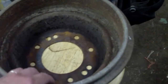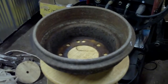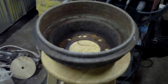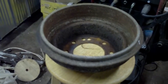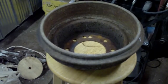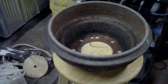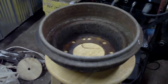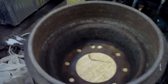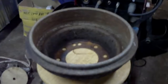That kind of tends to hint to me that the axle might be from something like a '67 to a '70 pickup, since those ones were 12-inch drums. And given some certain amount of wear, this one might have been worn outwards to 12 and an eighth. Although that's near the maximum diameter for the drum, it's more reasonable than expecting that this one has been worn three quarters of an inch outwards. So I'm going to spend some time this weekend trying to verify that.